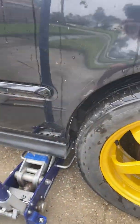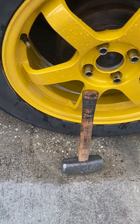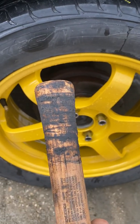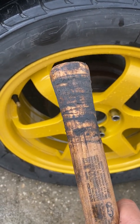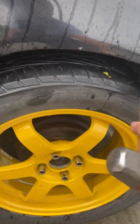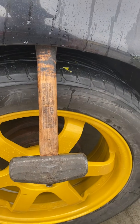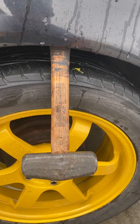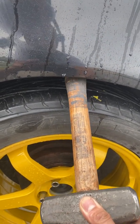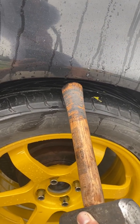So what I ended up doing was going into the bigger size. And so this guy right here, as you can see, I've already done the other side. But what I would do is I would just drop it right here, and then drop it right here. The neat thing about this handle is that it works very similar to those expensive fender rollers, where you roll the urethane wheel and bend this back little by little, just adding a little bit of pressure to the torque of the adjustment knob. I would just drop it on there, and the cool thing is there's a size difference. When I get to this point right here, it's really thinner, but as I work my way closer to the handle, it gets wider, and I'm able to get more torque to it. So in a sense, it has its own adjustment.